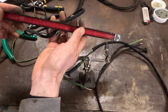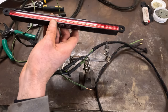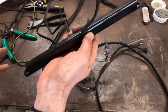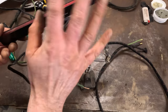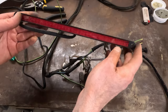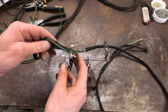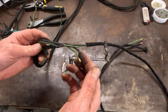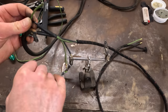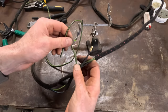I have one of these — an LED turn signal and third brake light that suction cups to the back window. I'm not a huge fan of this; I'd really rather not put it in the car. However, there are so many drivers on the road today and I plan on driving this, so something like this is just a little added insurance. I don't like the look of it at all, but I think the benefit of having it there outweighs the negative look. It's pretty small and not all that noticeable until it's lit up. So what I'm going to do is use that wire I was originally going to tape off to feed the right-hand side of this. Then I'll do a pigtail off of the left-hand turn signal wire to feed the left-hand side of this light.